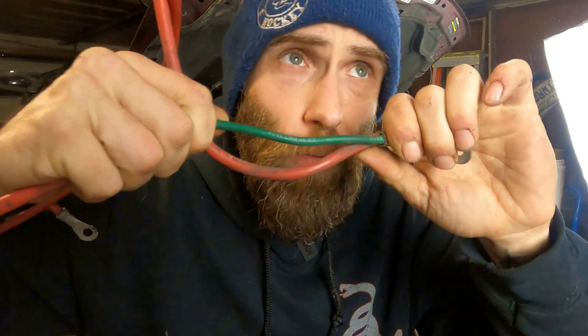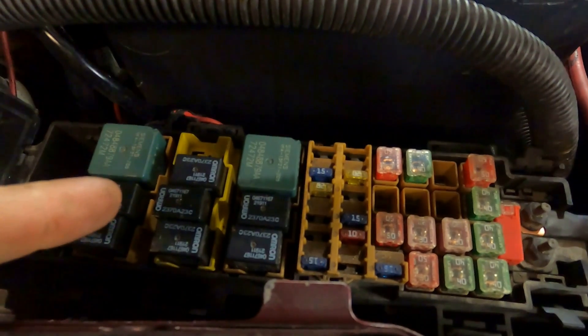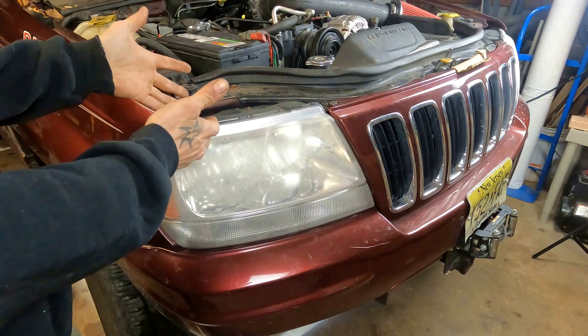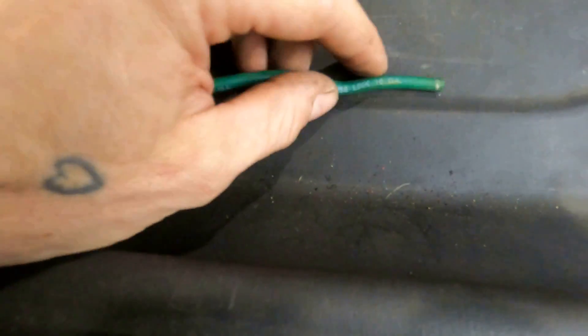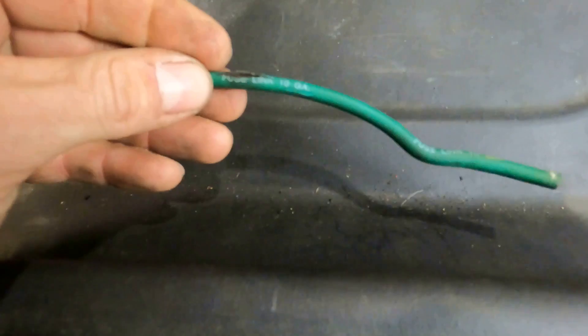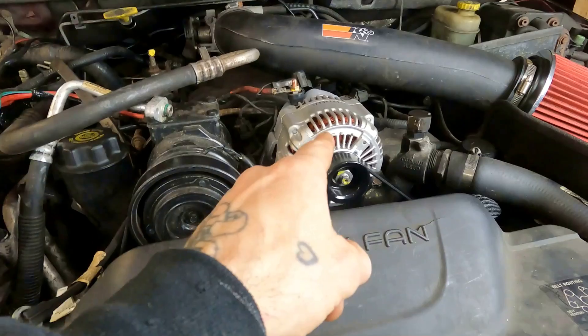It was at this moment I remembered a piece of information about the WJ that I had long known but never needed myself. In between the alternator and the power distribution block there's a fusible link. So if your alternator goes haywire and decides to send between 40 and 50 volts to the power distribution block that's expecting around 14, this thing goes all wet noodle on you — so that this sassy SOB doesn't let the magic smoke out and leave you walking permanently. I pulled the passenger side headlight to access where I was told the fusible link was. This is actually the fusible link I cut out of my Jeep on that day — you can see it's still got wire right down here where it formed, but up here it blew, melted right through the coating. That's what these are meant to do; they're sacrificial and obviously don't reset like breakers.